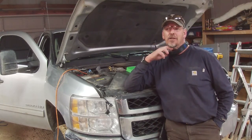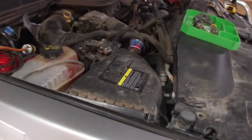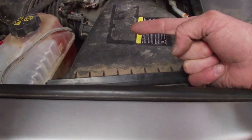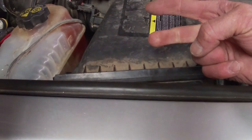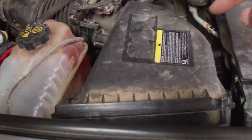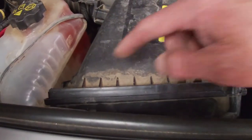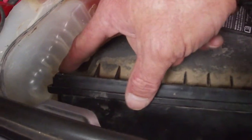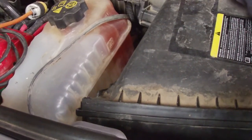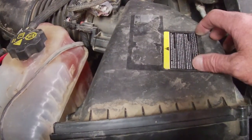So, let me show you how it works. Just a minute. All right. So what you'll need to do this job to change out these headlights is a Phillips head screwdriver, a 10mm socket with an extension, and an impact ratchet or whatever, and a 1/2 inch. On the passenger side, you take these two screws out right here on the air filter. There's one under there. Loosen, you need a 5/16 for that clamp there, and I need to tighten that back up still. A nut driver works great, or you can put it on an impact, whatever.